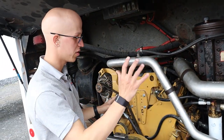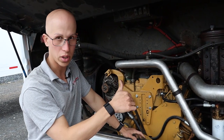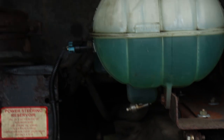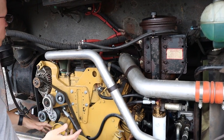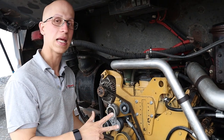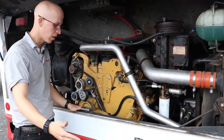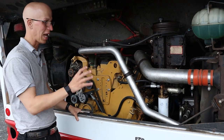There are also three items we cannot see on this vehicle: our air compressor, our power steering pump, and our water pump. If you follow the thick hose it leads to the water pump; follow the hose from the power steering fluid and it goes to the power steering pump; follow the air hoses and it leads to the air compressor. All those components are gear driven, operated properly, not damaged or leaking, and mounted securely. All my hoses appear to be in good condition and not leaking. We also check underneath the vehicle to make sure there are no puddles or fluid leaks from the engine and transmission.